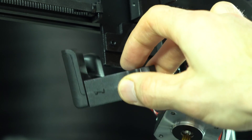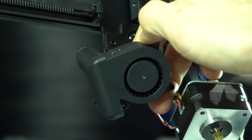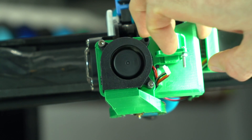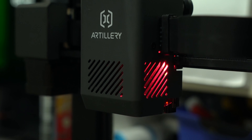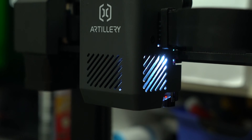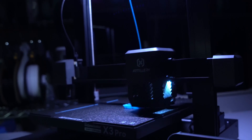The part cooling fan remains a 4020, but the shroud is now integral — molded together in a single piece — requiring that the fan be replaced if one desires to use an aftermarket shroud. The white nozzle light of the X1 is replaced by an RGB status light which changes colors according to the heating state of the hotend. A second light on the top frame enhances visibility in dark environments.